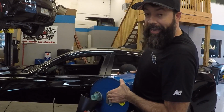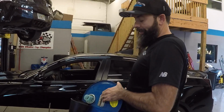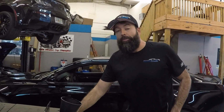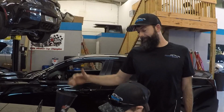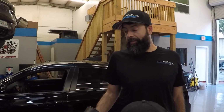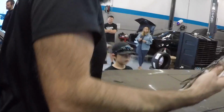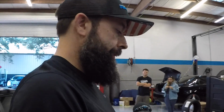Because I can't tune this, this is like a go-kart trick here. This fuel requires a richer mixture. We're trying to lean it out by fuel blend, so hopefully we should be somewhere about a 30% mixture of E85. That should lean our mixture out a bit. So, trying not to foul out the plugs, just gonna go for a quick little test drive. The weather is really nice. Should work out pretty good, I hope. A lot better than just being straight 93. Ooh, look at that. Reckon we're gonna see a little bit better.